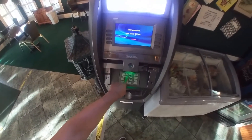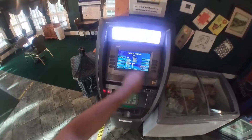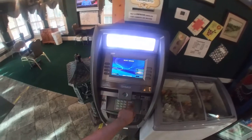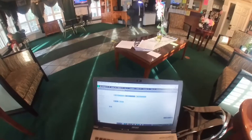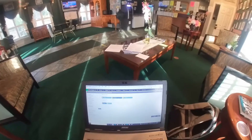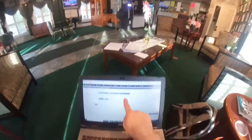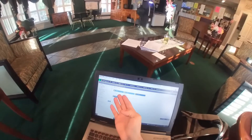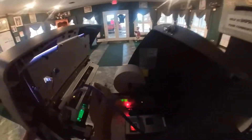The default password is 555555 and we're into the menu. It's brand new software, version 39. If you're familiar with Genmega, it makes mistakes. I did set up a terminal ID and I clicked wireless, but actually this connection here is internet — it's with a cable — so you've got to click internet. And if it's dial-up, which I had to deal with on my first dial-up earlier this week, you click dial-up.